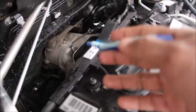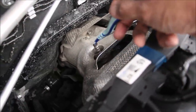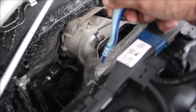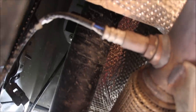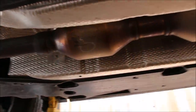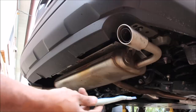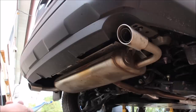Looking in and behind the engine, we have the exhaust manifold — it's just a standard steel type manifold with the air-to-fuel sensor at the top, not integrated into the head. It's got a flex pipe followed by the rear oxygen sensor. The exhaust then continues to the secondary catalytic converter and then to the resonator before heading out to the muffler. The muffler is actually a single inlet and dual outlet exhaust at the back.